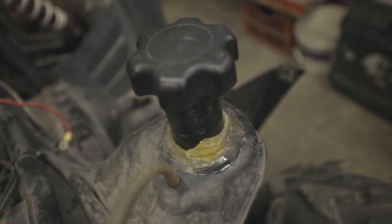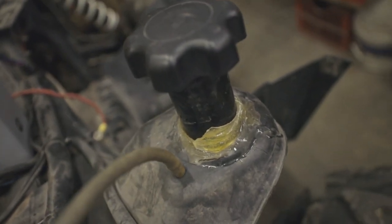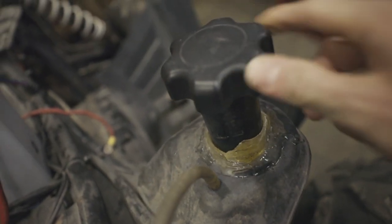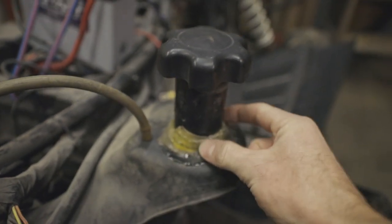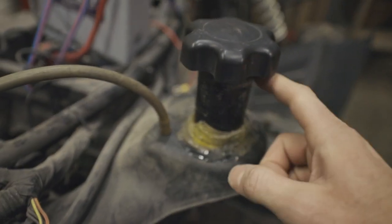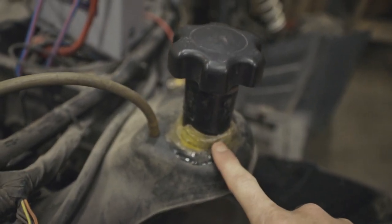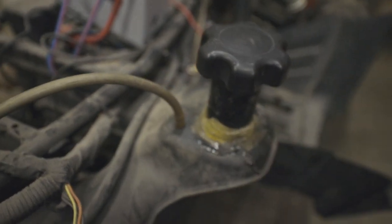We tried fixing the gas tank with some epoxy but that didn't turn out like I was expecting — kind of the same thing that was already there before. The epoxy just peeled away and our tank is a little loose there. What I'm thinking is just getting a rubber tube that will sleeve this and then clamping that on there, which will give the same effect they have on the Altra models with a rubber filler tube clamped on both ends.